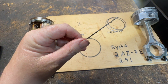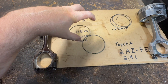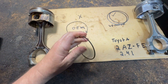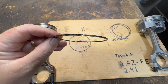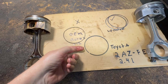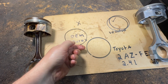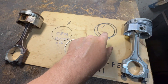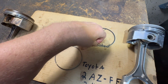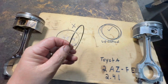Now what happens with the old design — it used a two-piece unit like this with a spring-type thing. This doesn't have the zigzag; it's just a spring that keeps tension on it. Now this one is all clogged up. These have little slits in them — about a half-inch slit, half-inch slit. It does the same job, but with this design the oil can't flow all the way around it.